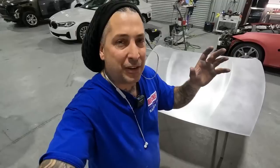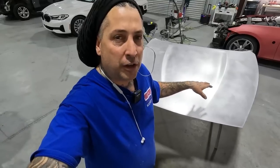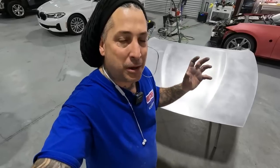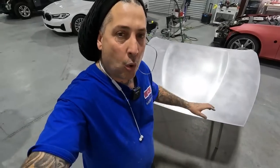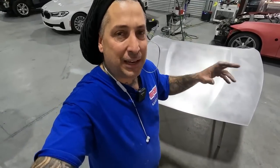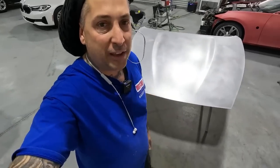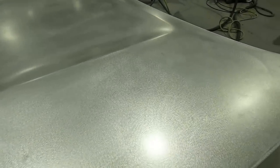That moisture from your airlines will start the actual corrosion process. When I did my Cutlass at my house I didn't do any priming there — I took it over to my personal shop where I have a refrigerant dryer. If you trap moisture underneath the primer or start corrosion, that paint job is going to be ruined — not right now, but in about six months you'll start to see moisture coming out or rust staining. Make sure you have clean airlines, otherwise all the work you do is going to be wasted.